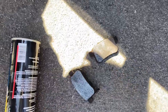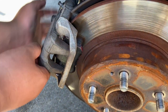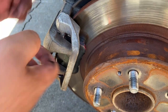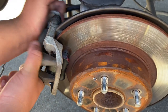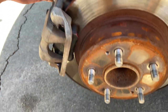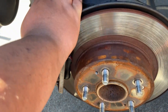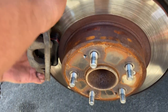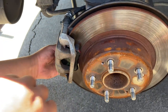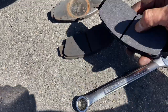Those are small! Just got the first set of rear brake pads in. It's a pretty simple procedure — you just shake out the old ones, grease up the new ones, fit them with the old hardware, and then bolt the two parts of the caliper back together.